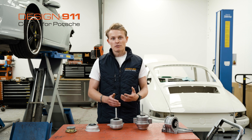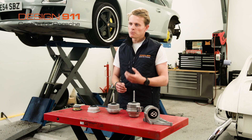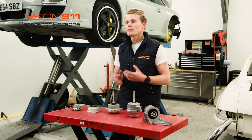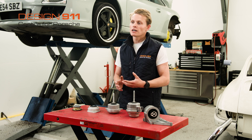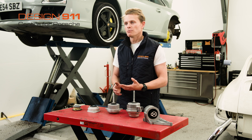The first sign is vibrations. If an engine mount becomes compressed or the rubber splits, its ability to absorb energy is massively reduced. As a result, you may be driving your car and feel much more vibration through the car. This is a sign of a worn engine mount.